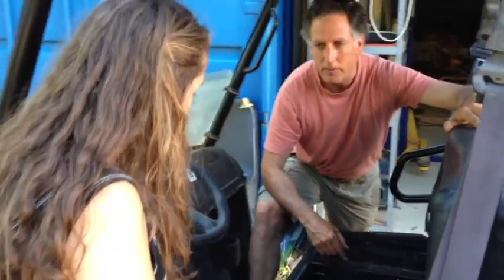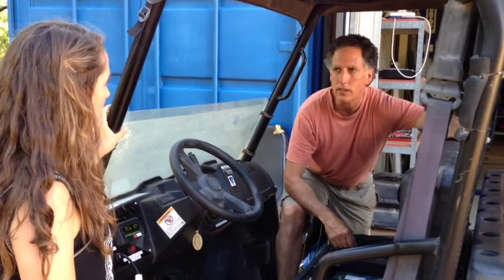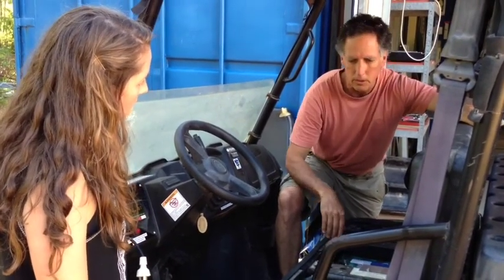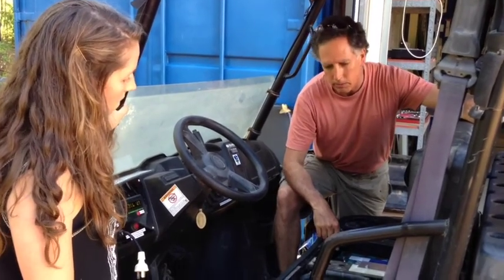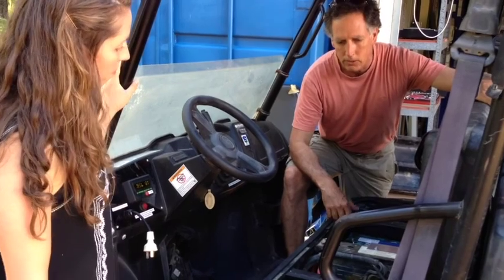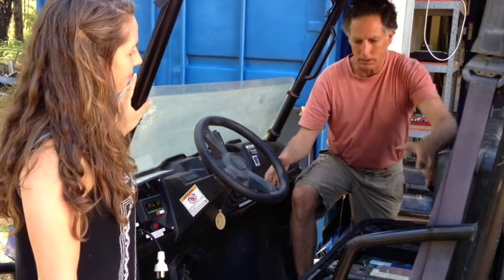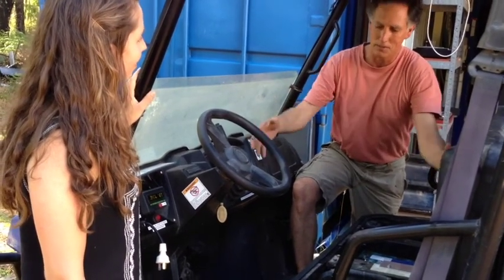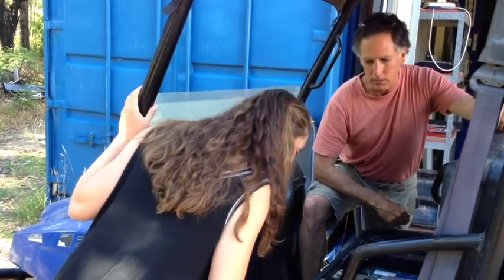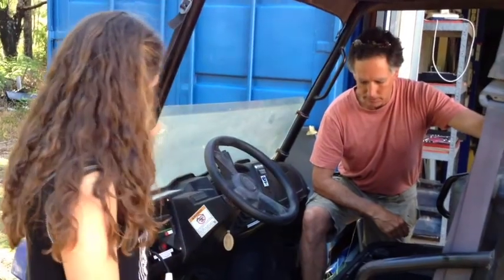So EV Power has done quite a custom solution as opposed to just replacing the batteries. That's exactly right — it's a customised solution for this particular job because it's working in a marine environment: very salty air and lots of beach sand. We had a pile like this of beach sand just out of it, and it was all rusty underneath, so we cut the bottom of the battery boxes out and got it all fixed up.